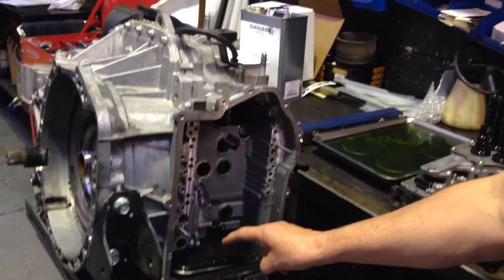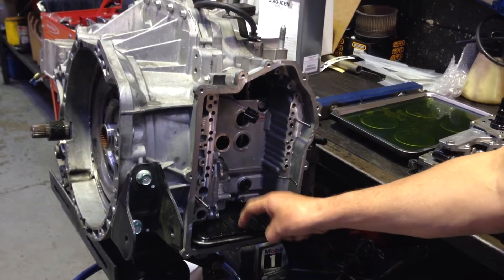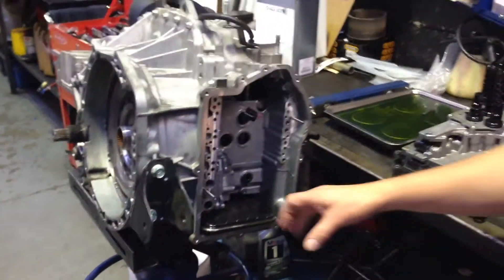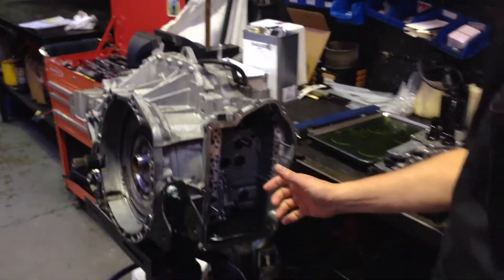This particular filter down here is one filter that is known to get dirty. The downside is to replace that filter, you've got to dismantle the whole transmission. We now supply these filters if they look like they need to be cleaned. But if they're not dirty, we don't want to remove them because it is a major job to split the case open.